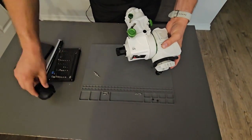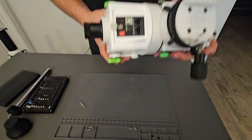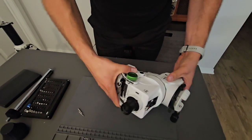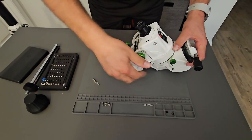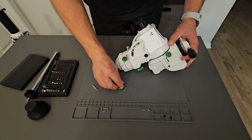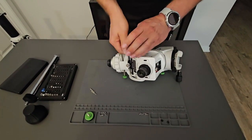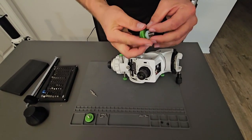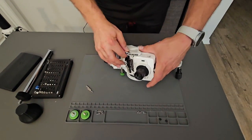We got to remove a few things — the issue is in right ascension. You can see just a little bit of play there, so we're going to take that slack out. We're going to take off our right ascension locks. Keep in mind they do have little plastic washers — one just fell off the table — so set those off to the side.